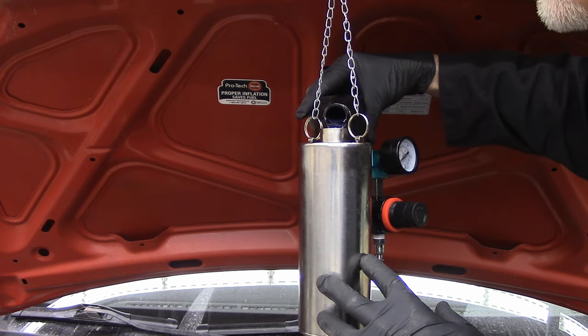Short term's kinda all over the place. Mostly it's trying to pull out fuel, which I guess makes sense, because if long term we've got 4.7 being added, right now it's like, oh my gosh, let's cut some of that fuel out of there. Short term is like the right freaking now. That's the ADHD of fuel management. Long term is not ADHD. So we're gonna see if that improves over time.